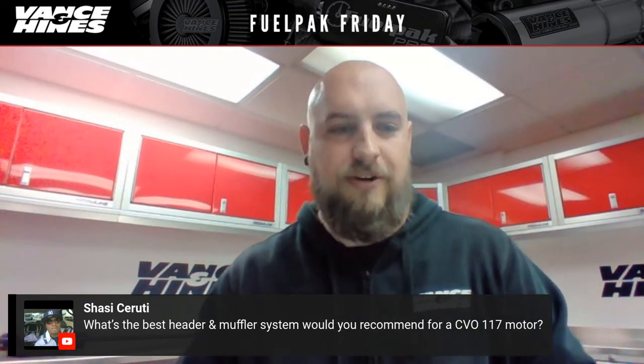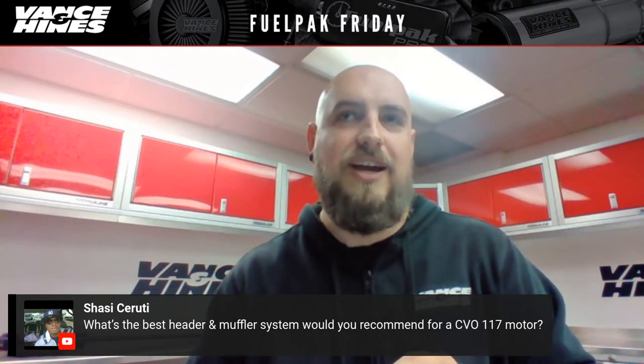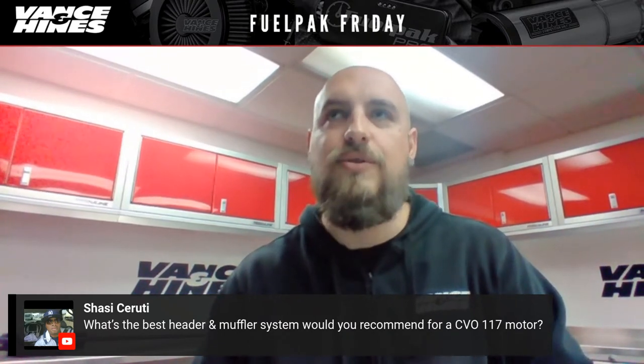Absolutely go with the Power Duals header. Don't go with the Dresser Duals. You'll lose bottom end torque out of it and you kind of kill the scavenging effect. So I don't prefer the Dresser Duals. I prefer the Power Duals all day long. They're a little bit more, but I think the bang you get performance wise is much more worth it.